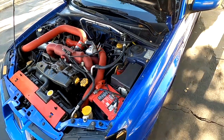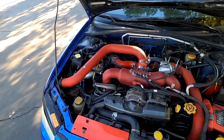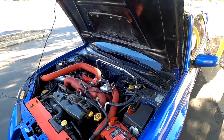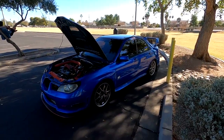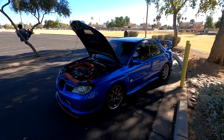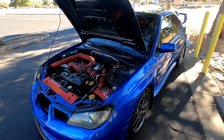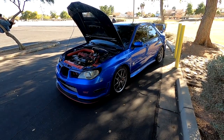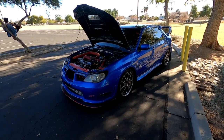I have learned that when you go E85 you can't let it sit for a while because your fuel lines might get eaten up — I learned that the hard way. I haven't had too many problems with it overall, it's been an amazing build. I've had about three problems: the fuel lines got eaten up because of the E85 sitting in it for about a month while I was saving up money for a clutch. Then the clutch went out. Now I have an Exedy Stage 2 clutch and it's been doing pretty well, treating me right.